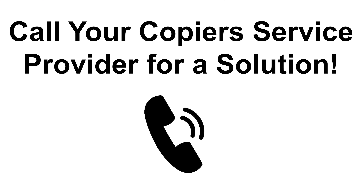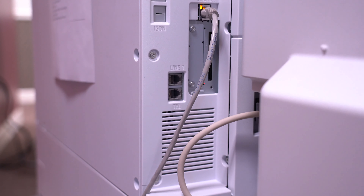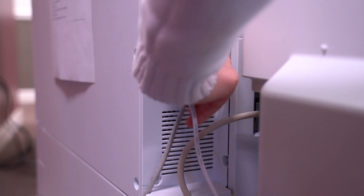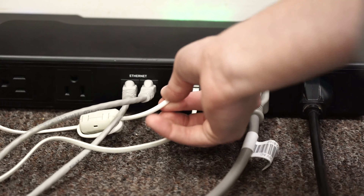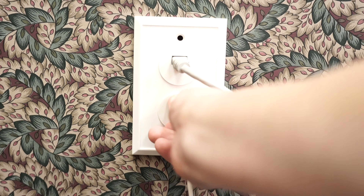If you see that your fax number is calling your cell phone and your machine is still not faxing properly, call your copier's service provider for further guidance. If you checked your dial tone and did not hear anything, you should check all the phone line connections from the wall to the copier. Unplug and reconnect each line — you should hear a click when connected correctly.